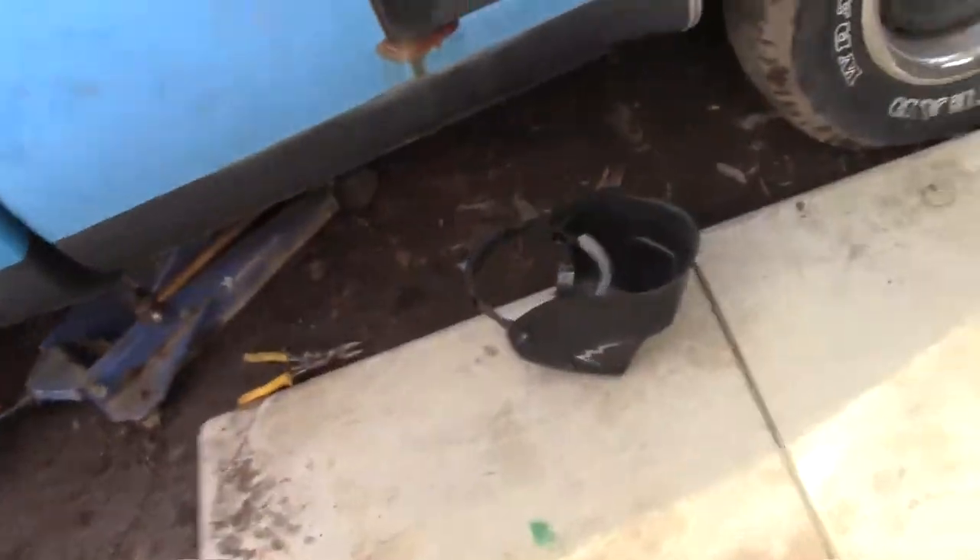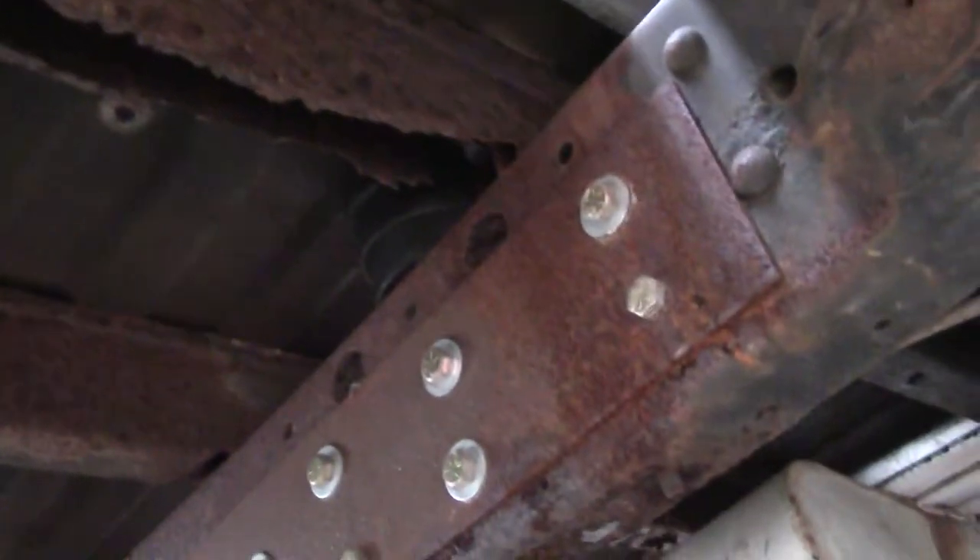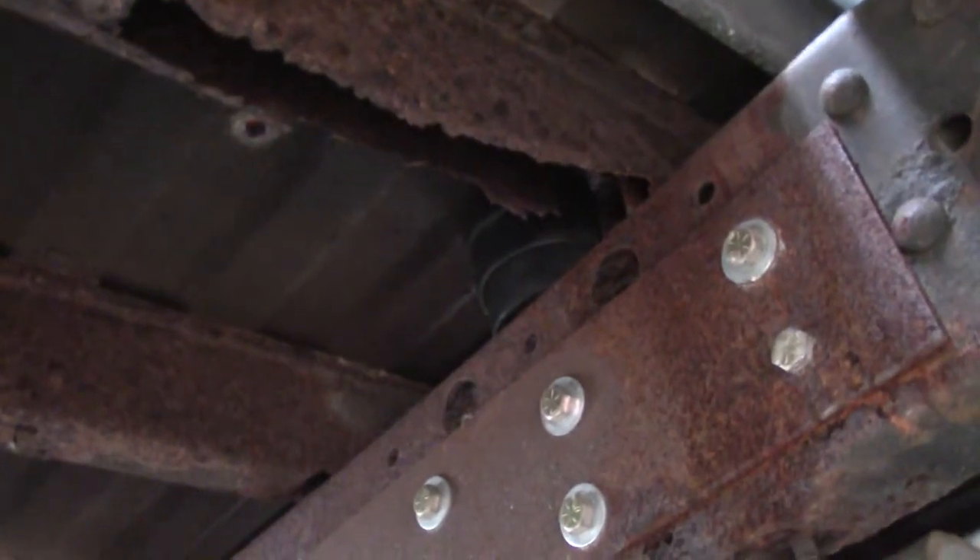I'll show you the other side of the framework. The previous owner did a nice fix of the bed mount — working in a small backyard here. It's hard to see, but you can see three hockey pucks stacked up top to keep the bed from — you can see it wiggle there. That's their temporary previous owner's temporary bed fix. We're going to try to get rid of all that. You can see the frame is pretty good everywhere else. You can see the plate put in there — that wasn't us — but you can see the rot there too. We're going to pull it out, cut out a piece to where it's good, and then weld her back in.